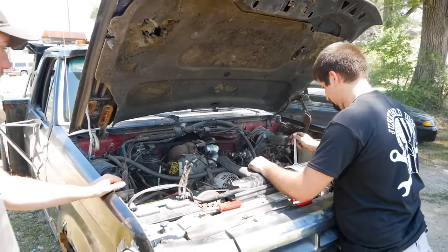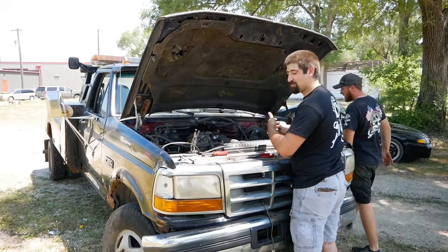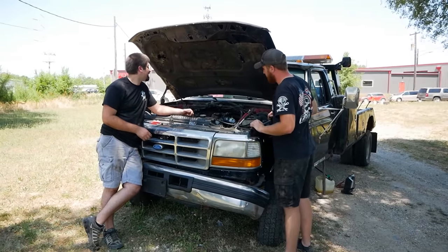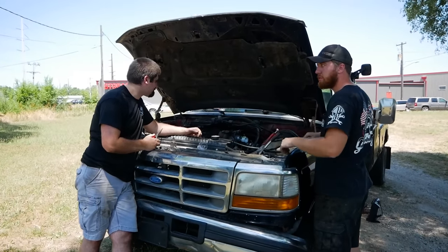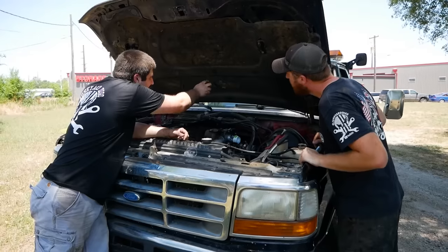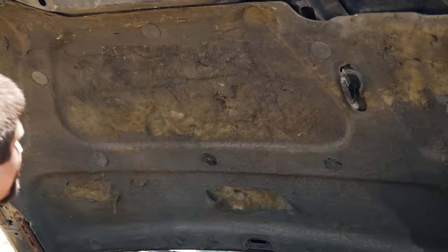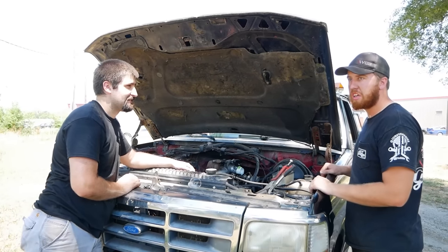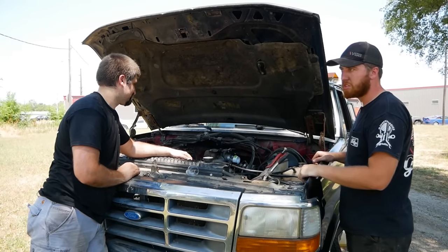Looking a lot better than it did before. Smell that? Diesel. That's power, baby. That was spraying a lot more diesel than it was last time, before we had this rendition of our fuel system set up. I can obviously see little spackles of stuff. So I think our main problem last time was fuel supply being non-existent, and with all the ether we just ran all the oil out of the cylinders and there was no compression left.